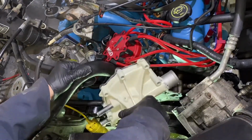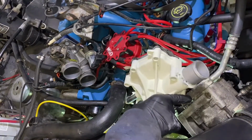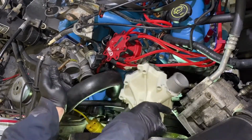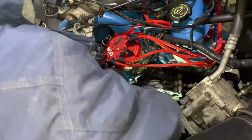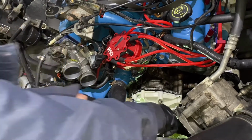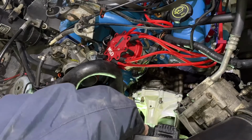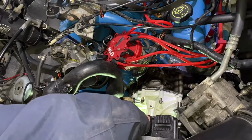So I'm going to go ahead and get us a bolt ready here, and I coated those with Never-Seez, so they shouldn't stick. If I have to do this again, at least I'll get them off. All right, got that one started. So they say finger tight until this stuff squishes out, and then leave it for an hour before you torque it.